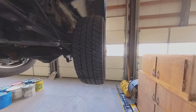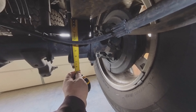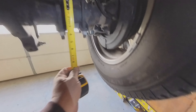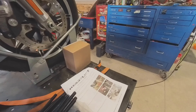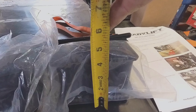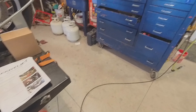I personally like a little bit of the factory rake, so I chose the actual lift kit rather than just a leveling kit. Here's the factory block — it's 2 inches — and here's the new block, still in the package, and it is 4 inches. So it'll be about a 2-inch lift in the rear and 2.5 in the front.